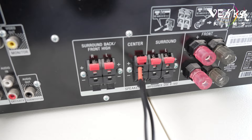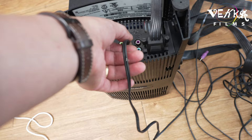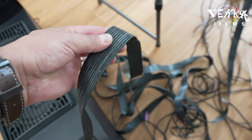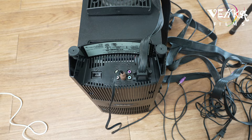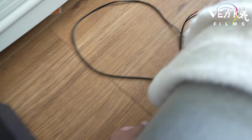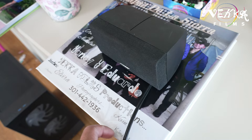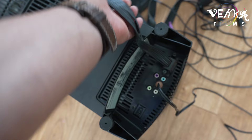Now it's connected to the center speaker port. You're asking yourself how am I gonna connect that to the actual speaker? Remember, we connected this center wire — this wire comes out from the subwoofer to your speaker. So the center wire goes there, comes here, and ends up here at the speaker. Connect it now — red with red, black with black. Now it's already connected.